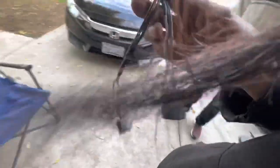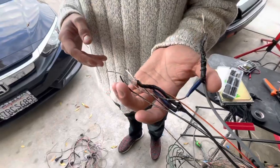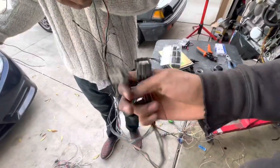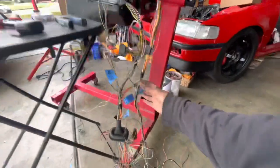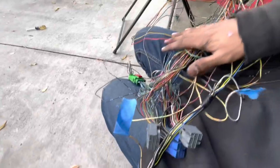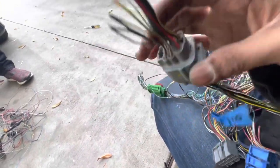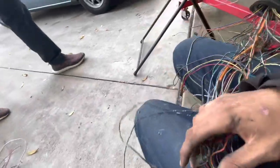This is all the crap I stripped out of the harness. The O2 sensors had nice shielded signal wires all the way to the ECU — I took time to de-pin those pigtails without destroying them, so those shielded wire pigtails are still good for other uses. As for the harness itself, we've got everything we don't need out of it — it's a lot lighter. I still need to figure out what this green plug is, and I ordered a plug from Classy Garage during his Black Friday sale for our ignition wires.